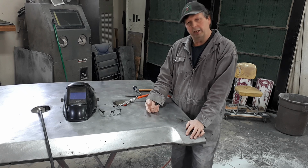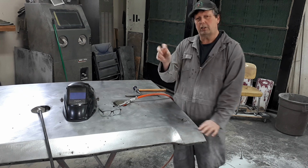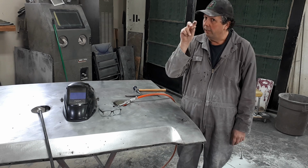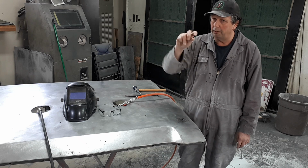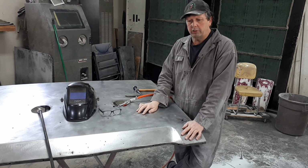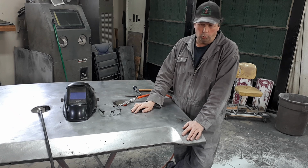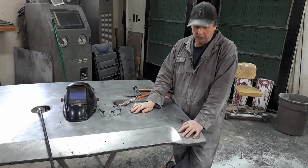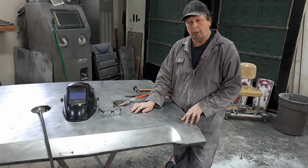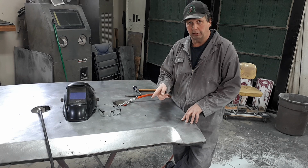So I weld on 1, and generally my wire speed, again on my machine, I don't have a clicker, I have a dial setting. I like that because you can tune it in, because it actually incrementally, not just one setting, speeds and slows the wire down. I generally weld at 2.5 to 2 3/4 for sheet metal work. So in doing this, I'm going to turn my wire speed up to probably about 3.5, 3 3/4.